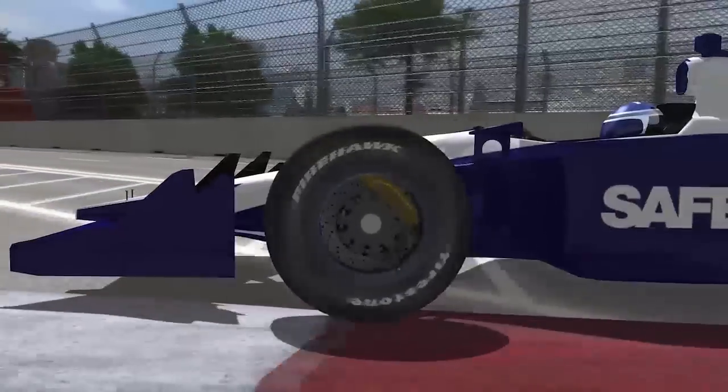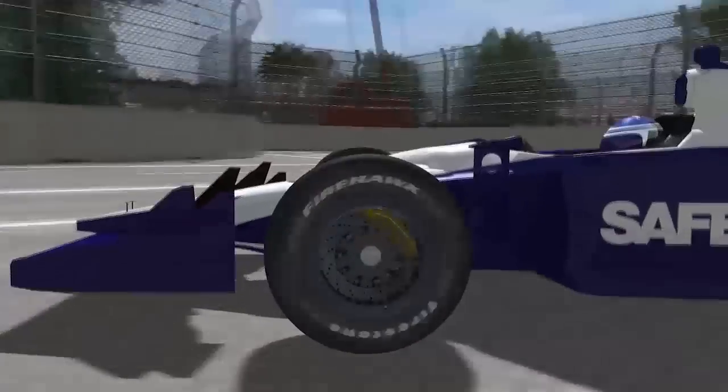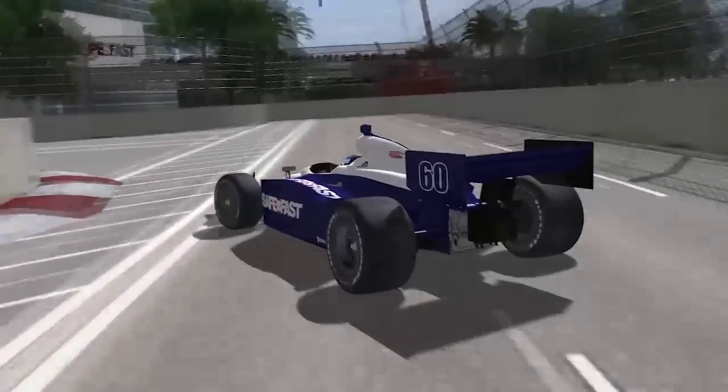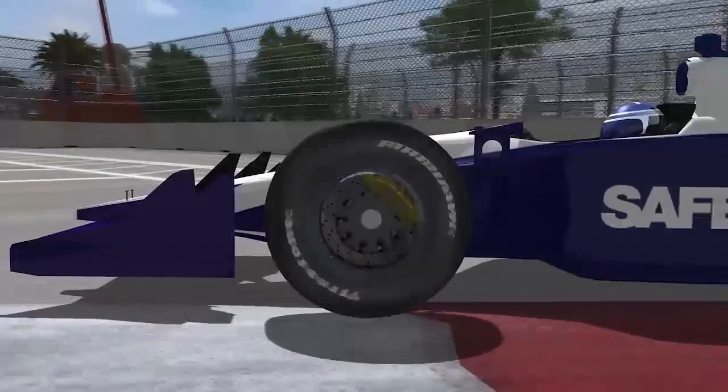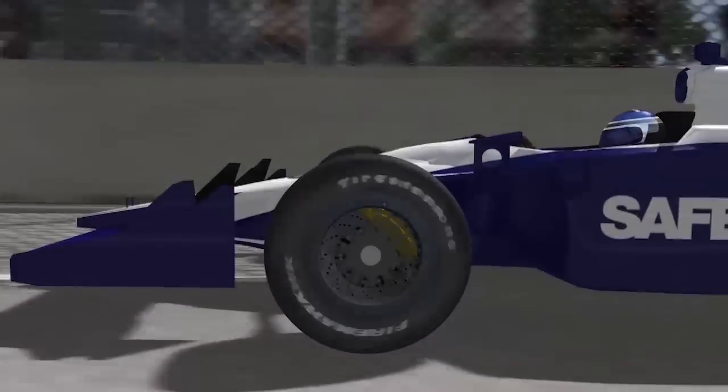A car with worn-out shock absorbers continues to oscillate over a bump. There's a little bit of decay just due to the bushings, but that is uncontrolled motion — meaning ride heights are changing, loads in the tire are changing, and all that takes away from grip. Shock absorbers are really important to control the mass and movement of the car, giving you much more grip out of the whole platform. Shock absorbers are the key to getting the last little bit of grip out of the tire. The suspension controls the tire position, and the damper controls the position of the whole car and the loads into the tire — so shock absorbers are the most important piece to get the most grip out of the car.